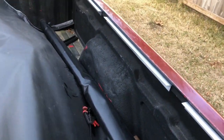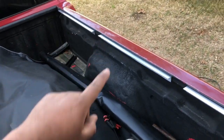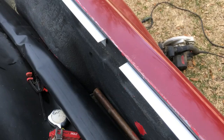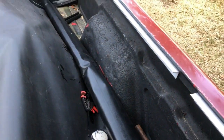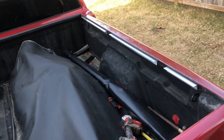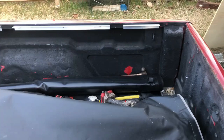Now the angle has been installed. This setup is going to be like a flush mount style, so everything will be leveled. Those two pieces are 24 inches, this one was eight and three-quarters, and the gap between here is three and three-quarters to accommodate a two-by-four. Originally I had thought I'd lay them in the vertical position, but it seemed like it would hold up better flat. Now that this is done we can go ahead and put the wood on, trace it out, cut it, make it flush, add the extra piece, and then get it to sit flush with the tailgate — then we'll wrap it with vinyl.